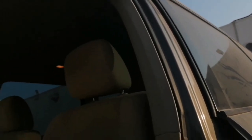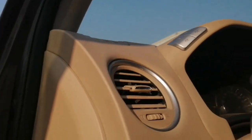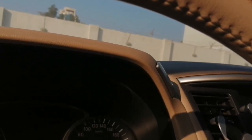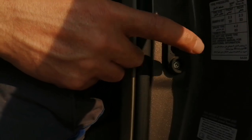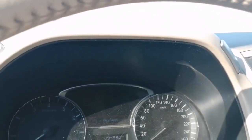I will show you how you can do it by yourself. First, you have to switch the ignition on. Then you see this door switch — after you switch on the ignition, immediately click this switch 10 times quickly. Then switch it off, and switch on again. It should be switch off first, then switch on the ignition, then quickly click: one, two, three, four, five, six, seven, eight, nine, ten — then off, then switch on again.